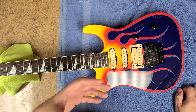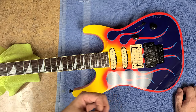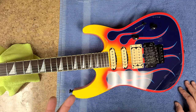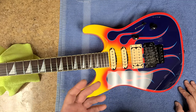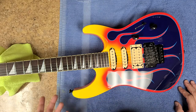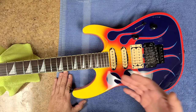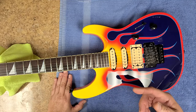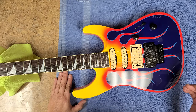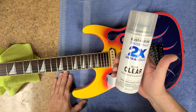The paint I used has a kind of gloss finish to it after it dries, and I could have feather sanded that in, but if you were to rub on it you may have a little bit of orange on whatever you were rubbing that area. So I figured I'm going to clear coat this — since the rest of the body's got a clear coat on it, I'm going to clear coat that area as well. I did the technique of rolling up the tape so it didn't make a sharp tape line and I was able to blend that in pretty good.